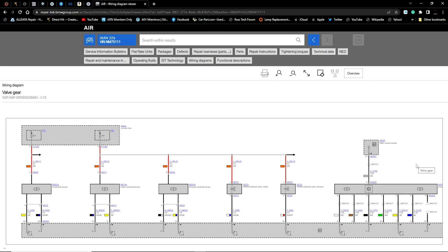For those who know this engine, the crank sensor is really hard to get to — it's under the intake, near the starter, at the bottom. So the best place to connect is right at the engine computer, which in this car is on the right side near the cabin air filter. You'll need to remove the cowl cover to access it — it's just a plastic cover.